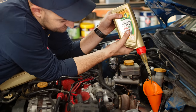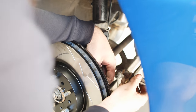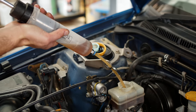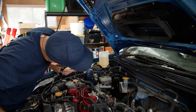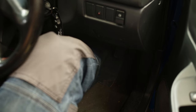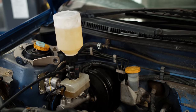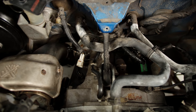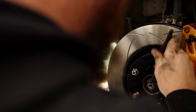The gearbox oil is filled via the dipstick hole using a funnel. Benny is adapting the later model ABS sensors to work with the older car, so we can then move on to the brakes. I'm going to suck out as much fluid as I can using a giant syringe, and then a filler bottle can be attached to the brake master cylinder — much like a funnel bucket for doing coolant. This helps keep extra fluid available so you don't suck it dry when pumping the pedal. With the pedal being pumped, the bleed nipples on the calipers can be cracked and fluid bled through the entire braking system. Next we're going to bleed the clutch — often just cracking the bleed nipple on the slave cylinder and letting gravity do its thing will get you most of the way there.